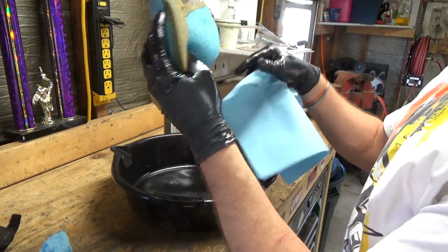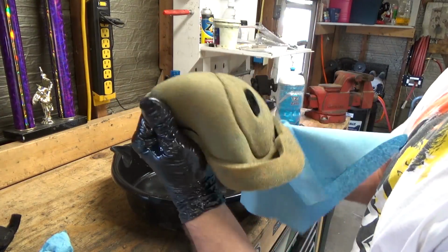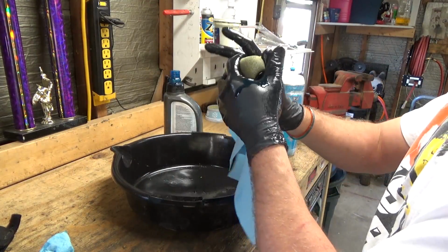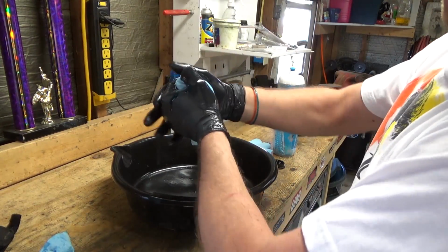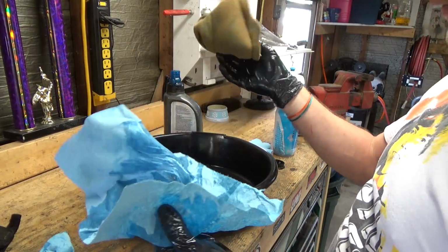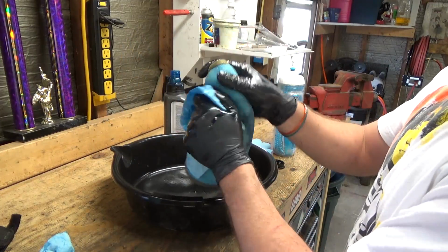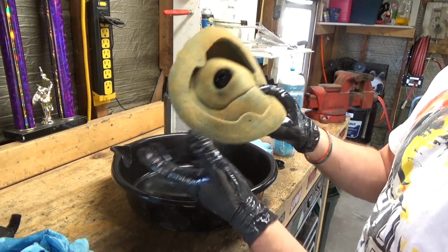couple of times. And then when I squeeze it too, I'll do it two different ways. I'll turn it inside out as well. And then again, you're squeezing it, you're not twisting it. You don't want to twist it, you just want to squeeze it. And again, I've had this air filter, I've probably washed this thing 50 times, and this works for me, and it's inexpensive. So then I come around and you can still see there's still some oily spots.